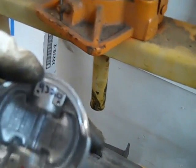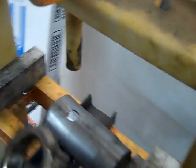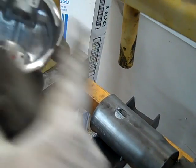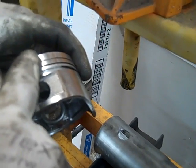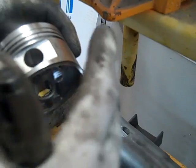What I did want to show is when we do a piston — see that 9320 — and if you come over here, these pistons are 9326, this one right here is 9325. The reason I say that is when you take your engine into a Napa or some standard machine shop, as a rule of thumb they'll just punch it for the number the piston's supposed to be. But when they're cutting the pistons at the factory from the castings, the tooling can be a little bit more — just a smidge. We build each motor, we build each cylinder in the motor like it's its own engine.